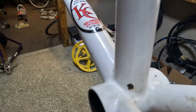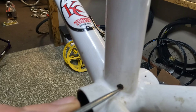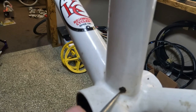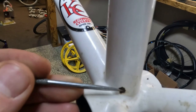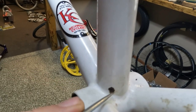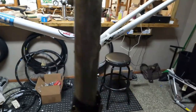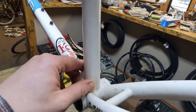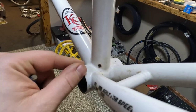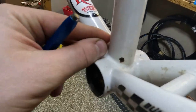There was a small paint bubble which you really wouldn't think anything of, but that means there is rust under the paint - those are areas of concern. I like to take a pick and scrape away the paint to see what's going on. In the process of doing that, the pick went right through the frame. The hole is probably three or four mils long. Moisture got in there, and rust happened and damaged it. If you looked at this frame, you'd think it was in great condition - which is why you want to look for paint bubbles and scrape them clear to check the area.